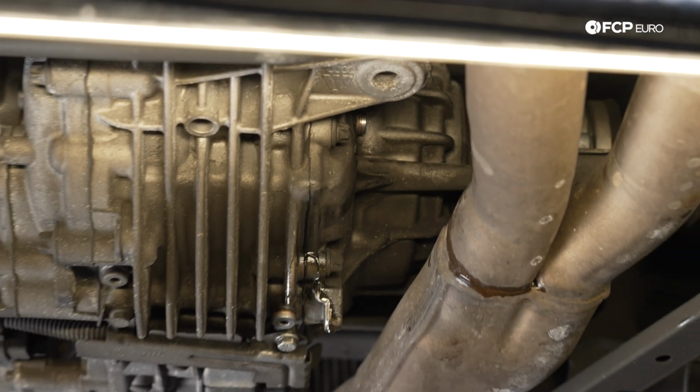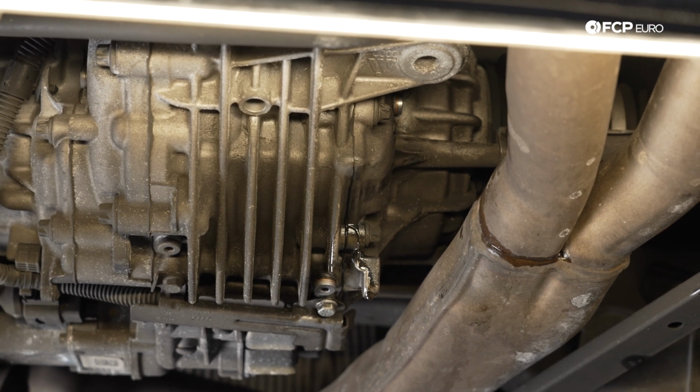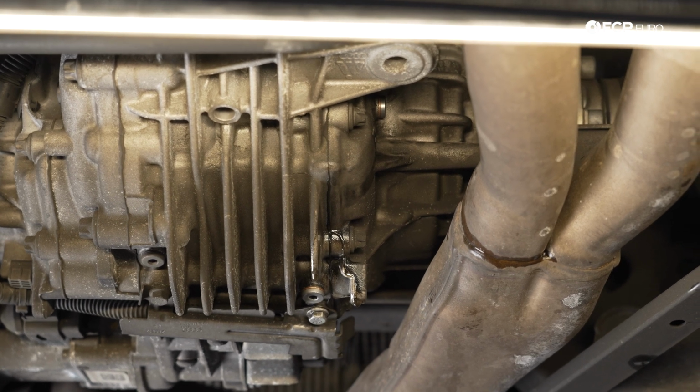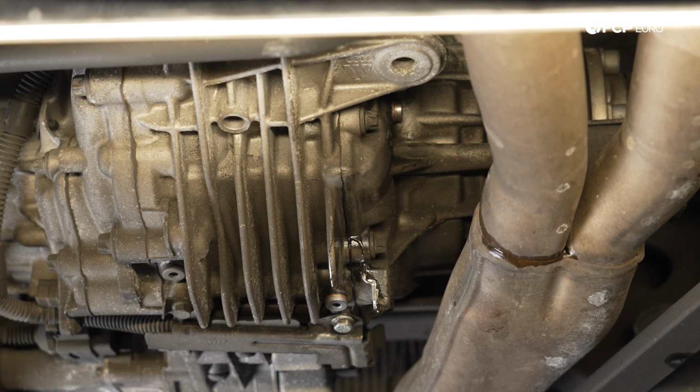And again, a torque wrench isn't absolutely necessary. As you saw, it was kind of bulky getting up in there. If you do have a 1/4 inch ratchet with a 5mm, you can more or less just give it a 1/4 turn once it's snug and flush. Now just go ahead and clean everything up and take the vehicle for a road test.